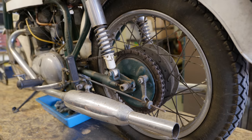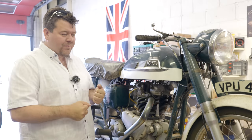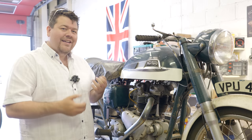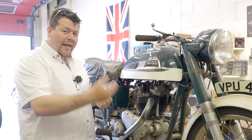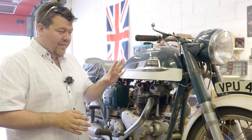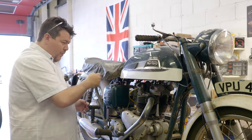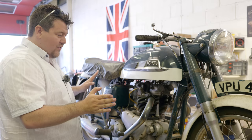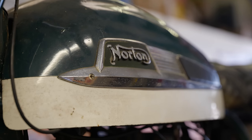Though today this looks like essentially any old British bike, it was actually something of a marvel for its time. The Norton Featherbed chassis was a real innovation — quite light, and it came from Norton's desire to have a stronger yet lighter chassis to use in racing. Previously their bikes had been very durable but quite heavy. They then experimented with a more lightweight frame but found that it would break. So this design was commissioned, which essentially has these two sections connected by several key points. This was very strong and very lightweight, and was regarded as the best handling frame of its type for a very long time.